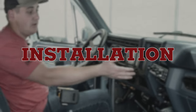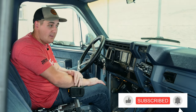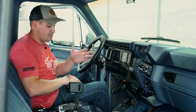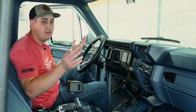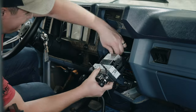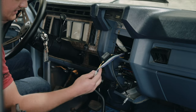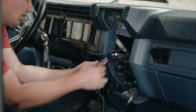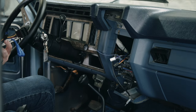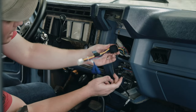We're inside the truck. As you can see, we already installed a classic Retro radio — the standard radio — in this very Bronco a long time ago. We chose the faceplate and knobs and it worked great, but it didn't fit perfectly in the opening. The Dallas radio is going to solve that. Since the harness is shared across all these radios and this is already installed, I just need to pull the old unit out and plug back in. The only change is swapping the main harness from Motor 2 to Motor 4 because of the Sirius XM — however the sub-harnesses are the same and plug right back in the exact same spots.